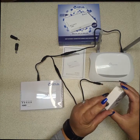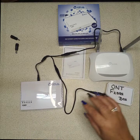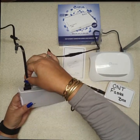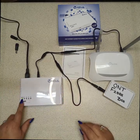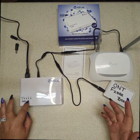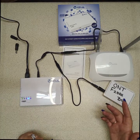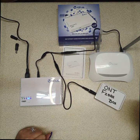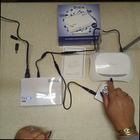Then we connect the ONT — and yes, you can see it does not fit, but we do supply extra plugs which will go in there. Connect that, then your power supply goes in. You can see the battery status is on. Hold this button in and the light comes on, and you'll notice the ONT fiber box has got power and your router has power.